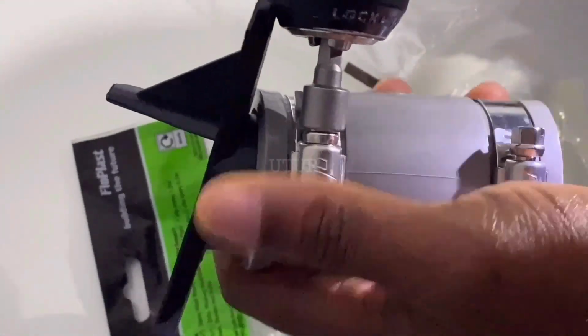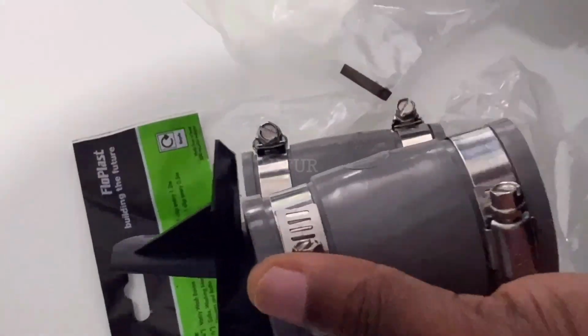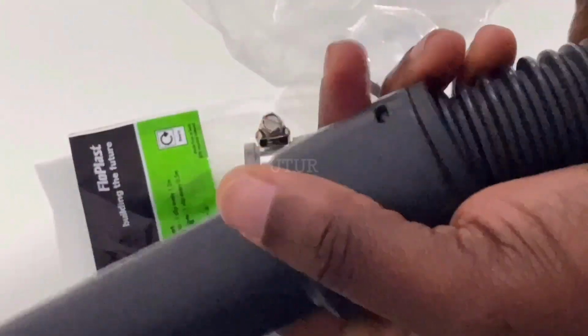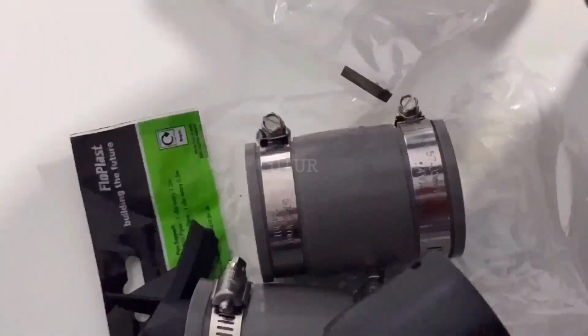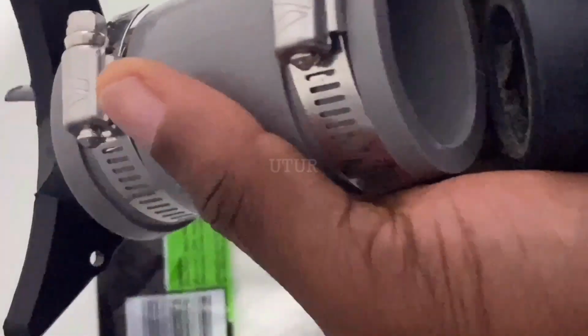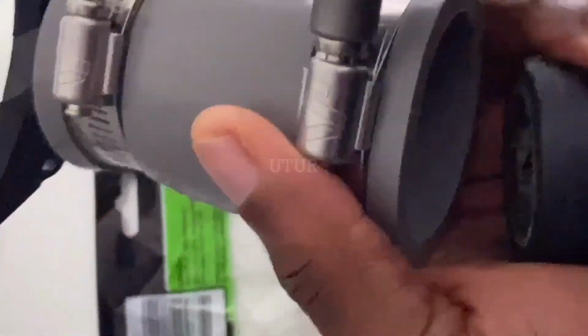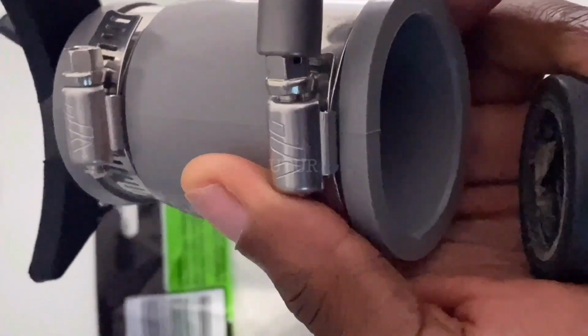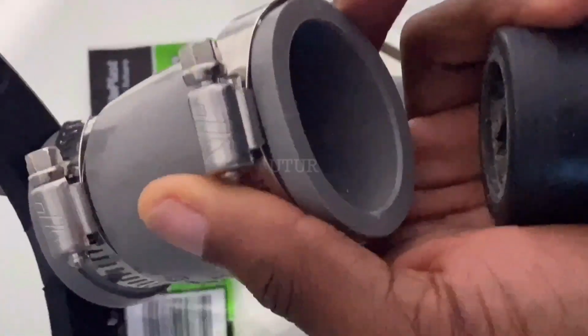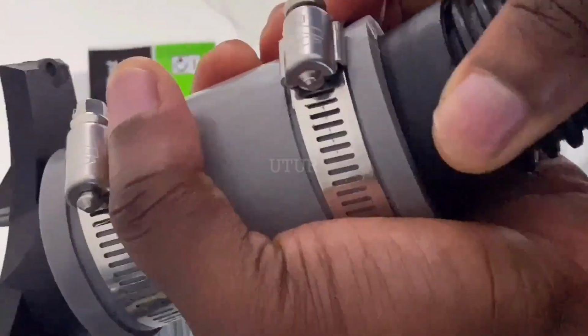And also, to reduce the risk of breaking the vacuum adapter, I will remove the non-flexible hose and just fit the flexible part of the hose onto the coupling. So get your flathead screwdriver into the notch there, and remove that clip from one end and the other clip, and that leaves you with the flexible part of the hose only. So kind of like push fit that into the coupling, and if I can't get it into the diameter of the coupling, I would undo the screw so that I get more room there, and then push fit the vacuum hose into the hole.